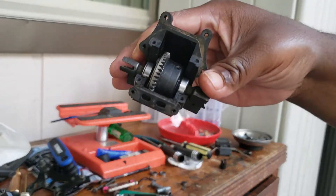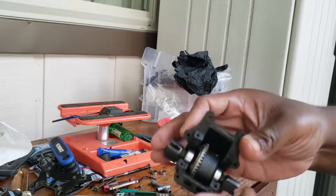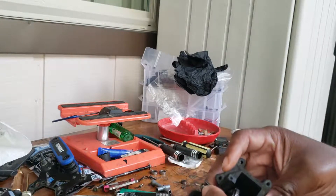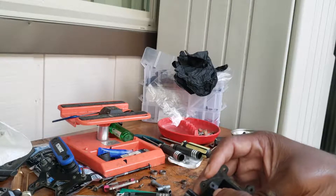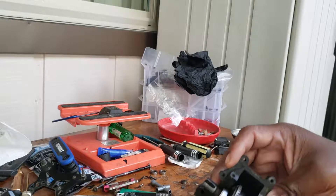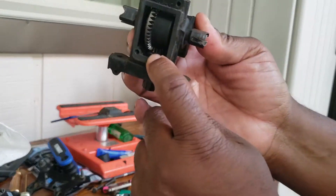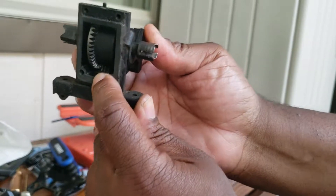You can see it's complete. I've got two shims there — what I do is from the factory it's one shim, but I usually add another shim to bring the mesh a little closer to the input gear. There's not much play in there.